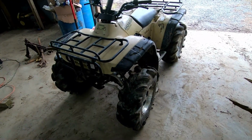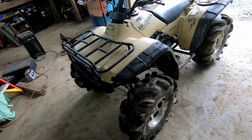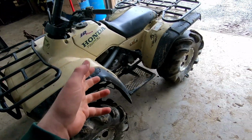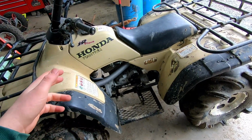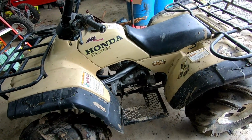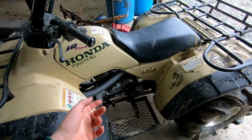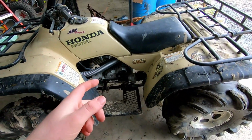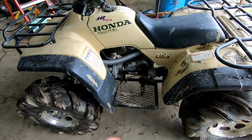For those of you that may not know, I'm going to do a quick rundown of the build information on this 300. It's a '98 300 third gen. For engine work, we have a Greg Jr. JR Trike Sports 333 big bore kit, 12:1 compression, running on 100 octane fuel, gear reduction 54%, Ron Shaw, running EBC clutches with a stock 300 primary.